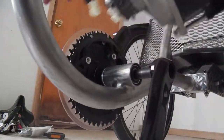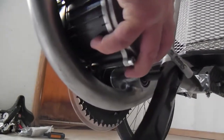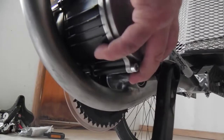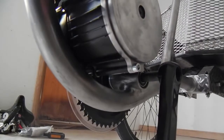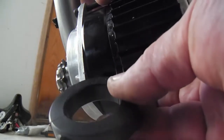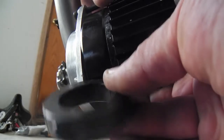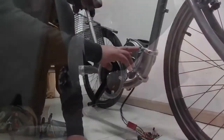You see, there's the sprocket, there's the outer sprocket. We're going to get them lined up. And the best reference point I think I can have, and I kind of already know where it is, is on one of these bolts. I'm simply going to mark a line, a half. That's where it's going to be referenced. Take those two together, and this can go wherever it wants, even around the curved area of the tube. Once it finds its spot, when you clamp it down, it won't move in conjunction with the other one.